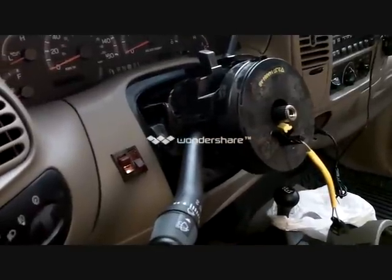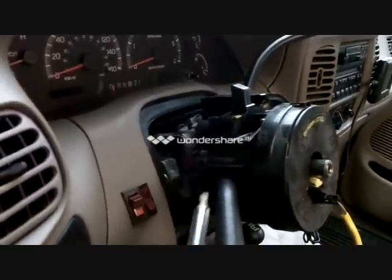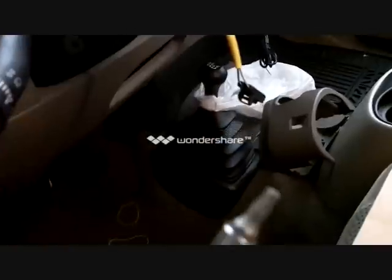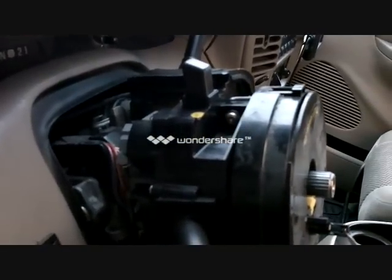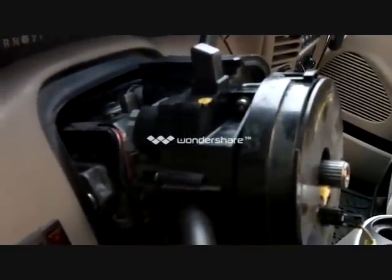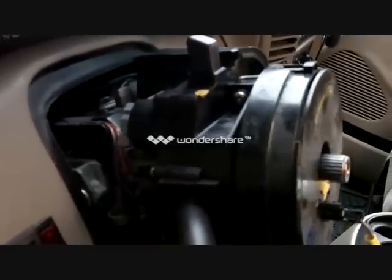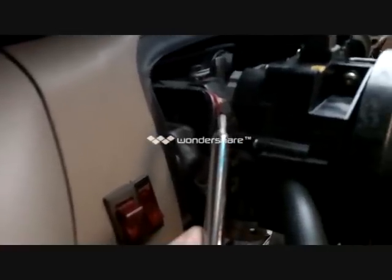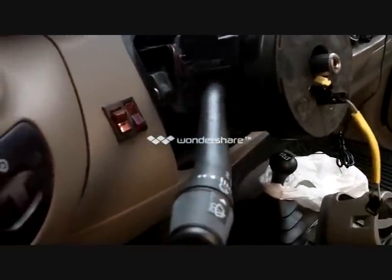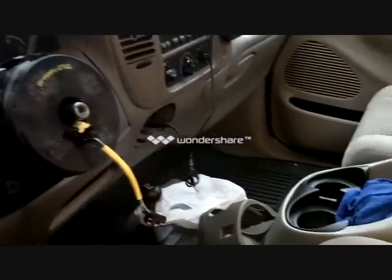I've put the multi-switch back into place with the Torx head screws — it's a Torx head size T20. When you put them in, put each one in and just snug it lightly, then give the unit a little shake to make sure it's secure and then tighten them up. Never tighten one up fully before you get the other bolt in. You can see just a little glob of silicone on the side here — that'll keep that wire from ever backing out. So now we'll get the cover back on.